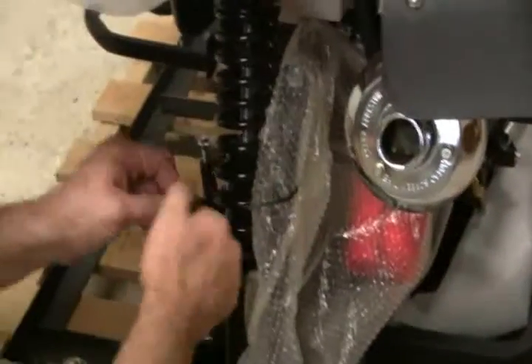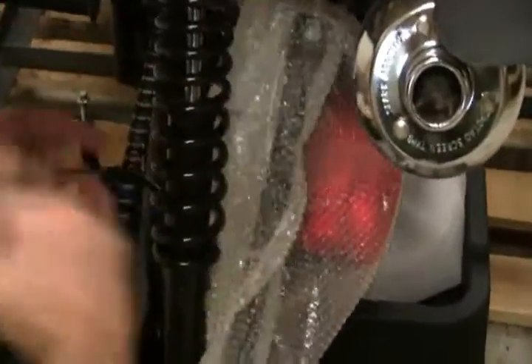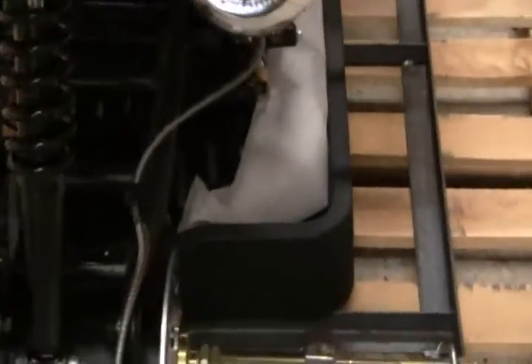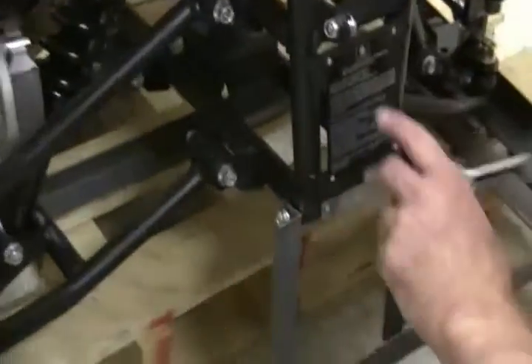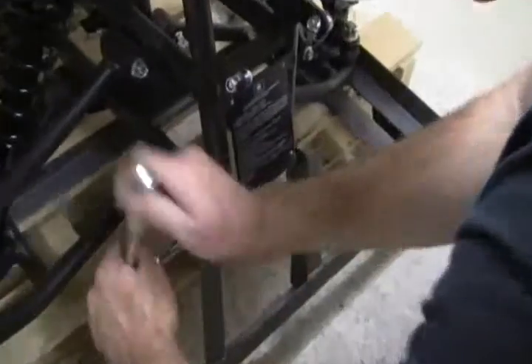This piece here is used to put on the rear tail light. When you remove that, just look at the brake line — we've never had it happen, but something could wear through the brake line, so just look at it and make sure it's well. We have pieces under here — looks like we're tied down. On the front here we have two bolts, one on each side. This is not one long bolt with a nut — just to let you know — and we're just going to take them out.